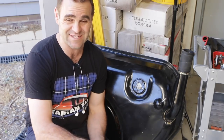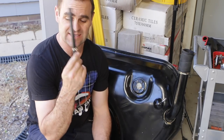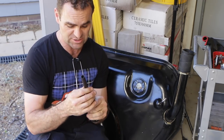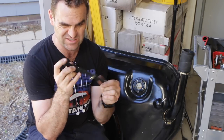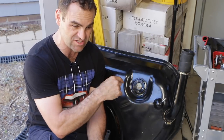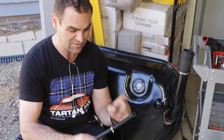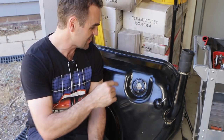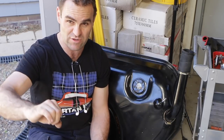After a lot of messing around and physically pulling the tank out, I came to realize that the dash-6 line is not going to fit. I was going backwards and forwards with Jamie from Raceworks over what to use. The issue is that the AN stuff is based on imperial sizes but the sizes on the tank are metric — so we're trying to get the best match. It's just where I have to connect up to the original fittings that's the problem, because the lines out of the tank are a 12mm feed line and an 8mm return line.